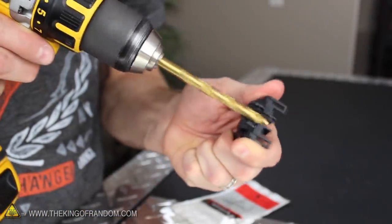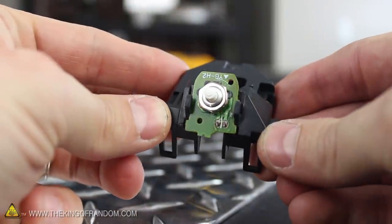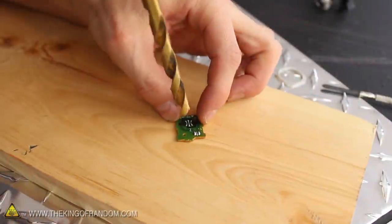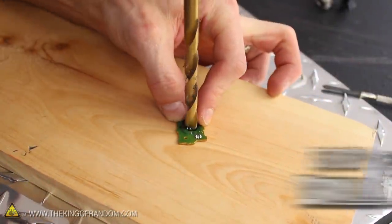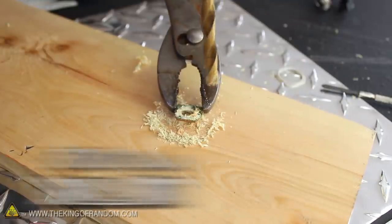I tried using a 5/16-inch bit to carve a channel halfway through the casing, which keeps the brackets for the circuit board intact while creating just enough room to accommodate the button on the inside. Now if we dig up the original Z button circuit board and cut a 5/16-inch hole straight through the contact pad, we should end up with a hole the right size for our switch.